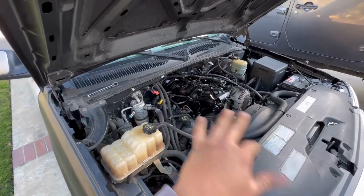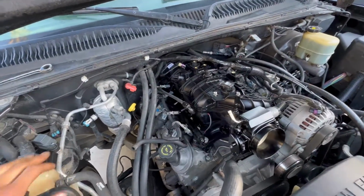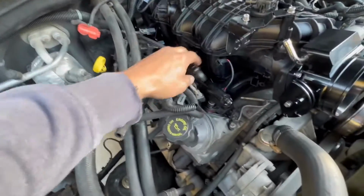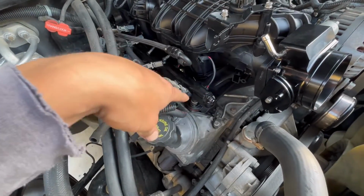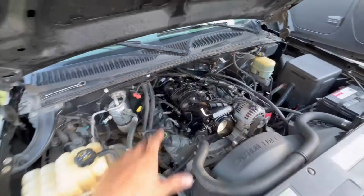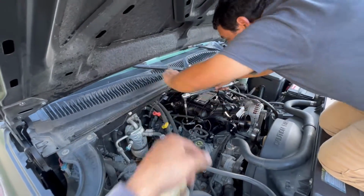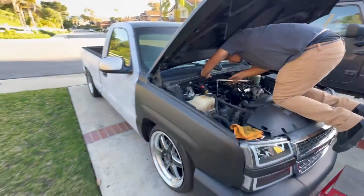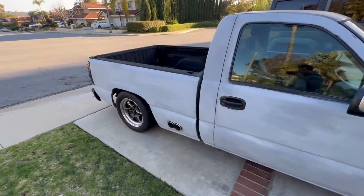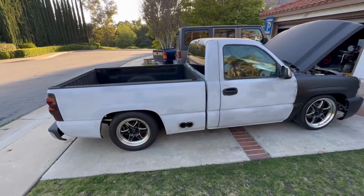And if you guys have seen my other intake manifold video, all the other lines, hoses, pretty much gonna just connect where they're supposed to go. Map sensor, pretty simple. We're gonna use the same exact route for the fuel rail, the feed to the regulator. So it's pretty much same thing. So now we'll go ahead and just torque down all the bolts, 7 foot-pounds if you're doing the job. And then we'll go ahead and get it started, fellas. Get a few revs, get a little dry POV, you feel me? Then that should be it, man.